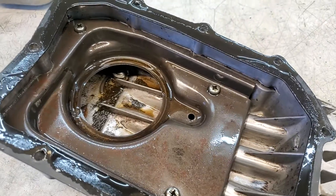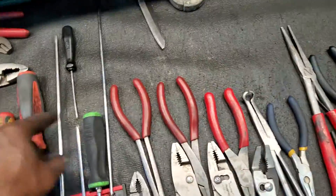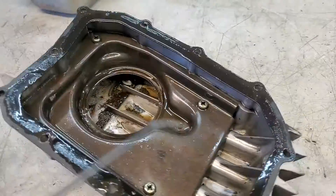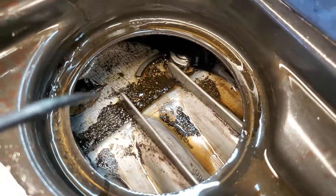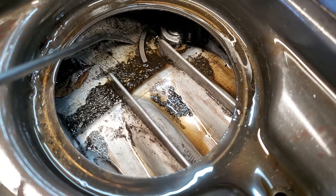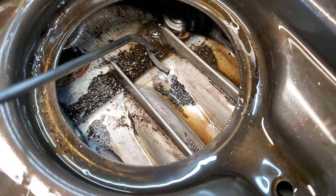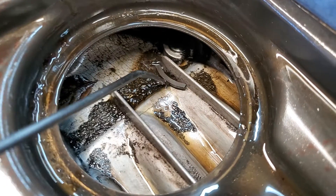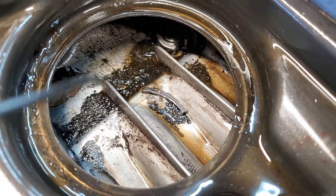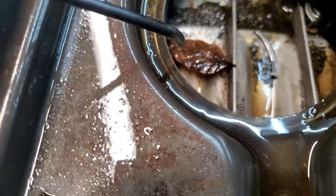You may recognize this part. Here's your oil pan — if we go in here really close, you see this big piece of metal lying in the bottom of your oil pan. You might be thinking ring end gap for a piston, but I'm actually thinking this is a main bearing. Actually, looking at it more, it does look like a ring. And look — there's a leaf in there. What the hell? That's just crazy.